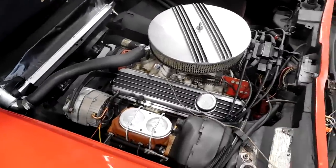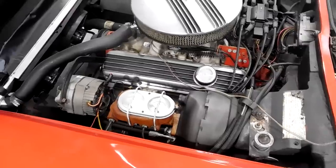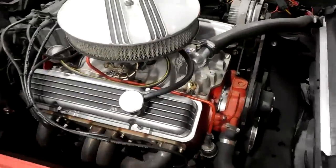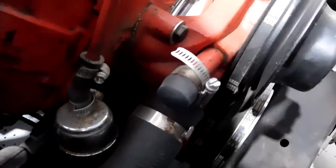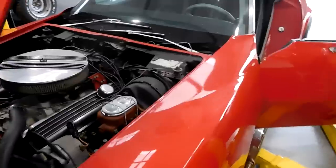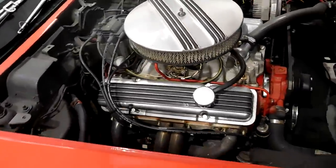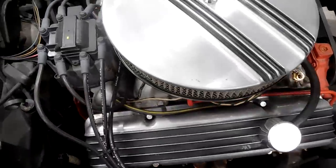In the whole time I've been with this car I've never heard it run or anything like that, but we're gonna see how bad it ended up being. I don't know if it's an original engine to the car — we can check that really quick. There's the stamp pad. Ends in 4627. Yep, it's the original 350. So I don't know if he wants to keep that or what he wants to do, but we've got to take it out — that's the main thing.